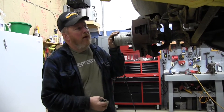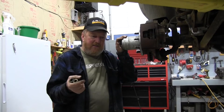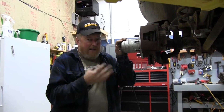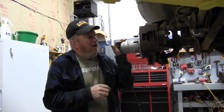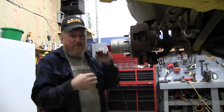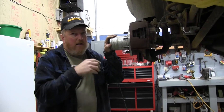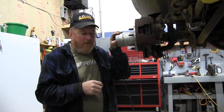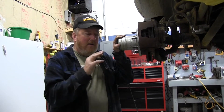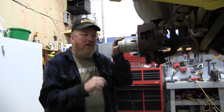Overall we're really happy with this conversion kit. It stops everything from spinning all summer long so we don't have to use four-wheel drive unnecessarily. Another nice benefit: because we haul big trailers and this is a standard transmission, we can now put it in low range with the hubs locked out and have low-range two-wheel drive for backing up trailers — no more riding the clutch. The kit uses standard inexpensive tapered roller bearings you can buy at any auto parts store and repack any time. It also keeps the wheel spacing exactly the same. That's our one-year review on the Yukon conversion kit for this Dodge.